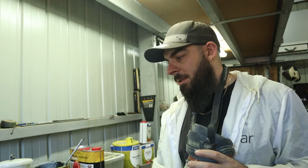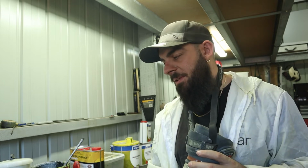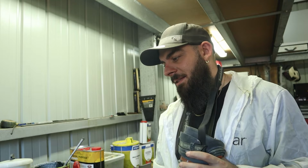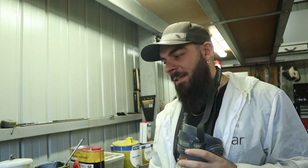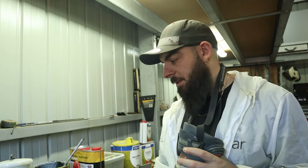Performed quite well. I did get a few runs, but that's because the engine bay is so intricate for an old car as well, and I'm sort of a little bit out of practice in that sense. So there's a few runs I have to contend with, but it is the epoxy stage anyway, so it doesn't matter. Once I remove the run and I cut back to bare metal, well, I'm going to be dusting some epoxy over areas anyway, so wherever I cut back, getting rid of those runs, I could just spray a little bit over there. So.